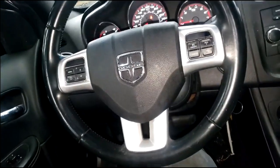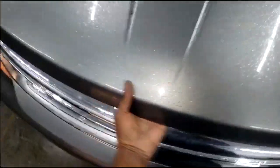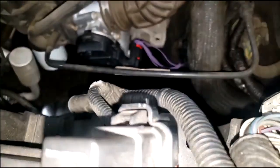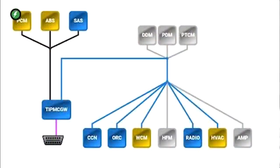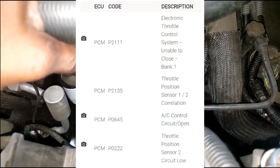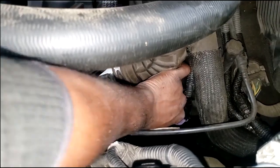That's a no-go — this thing failed. So let's go outside and look under the hood. I didn't think it was going to be that simple. Sometimes you get lucky with a simple job, sometimes you don't. They did replace the throttle body. Based on the fault codes I'm getting — open circuit, short to ground — I think this thing is simply wired wrong.